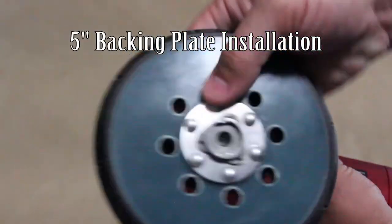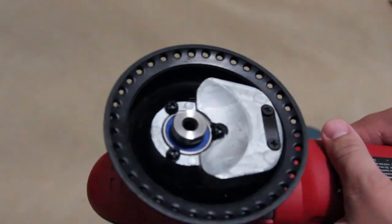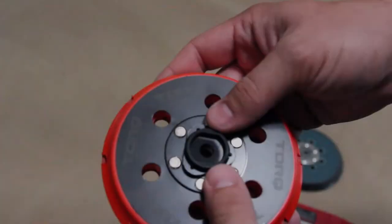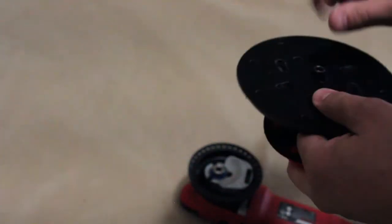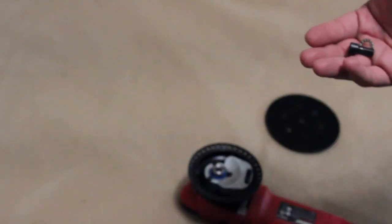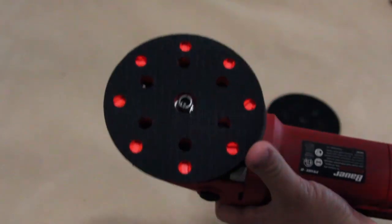Now we are ready to install a 5 inch backing plate. In my hand is the factory 6 inch plate that was included. If you found other videos referencing an Astro brand plate with a stud installed, that will not work on this polisher — the Astro plate is made for the original Harbor Freight polisher similar to a Porter Cable dual action; they don't feature the same design for attaching the backing plate. The good news is the Chemical Guys Torque 5 inch backing plate will work on this polisher. Notice on the Torque plate how there's a flat molded into it just like on the factory plate — you'll be able to reuse the same socket head cap screw that came from the factory. Just make sure you pull out that serrated lock washer as well before attaching the Torque plate.